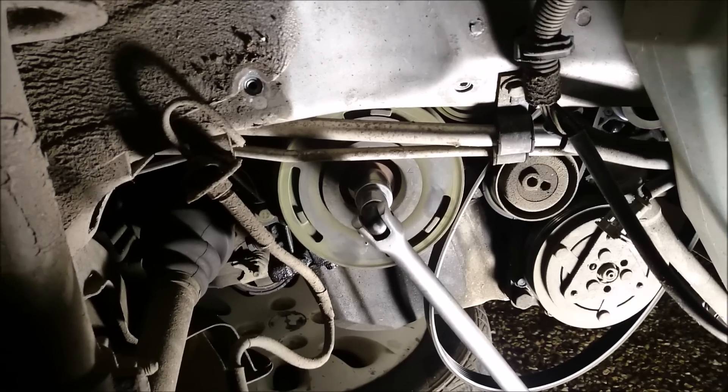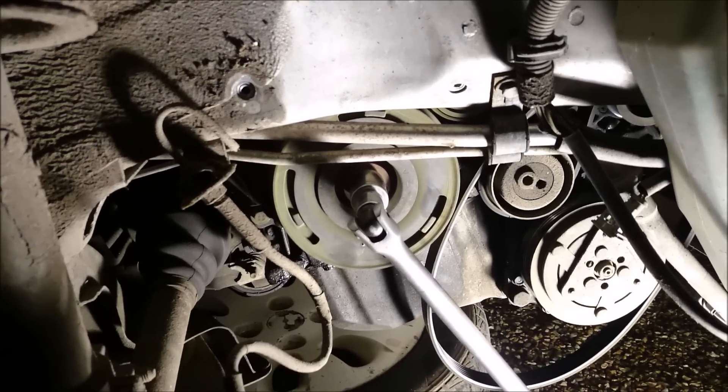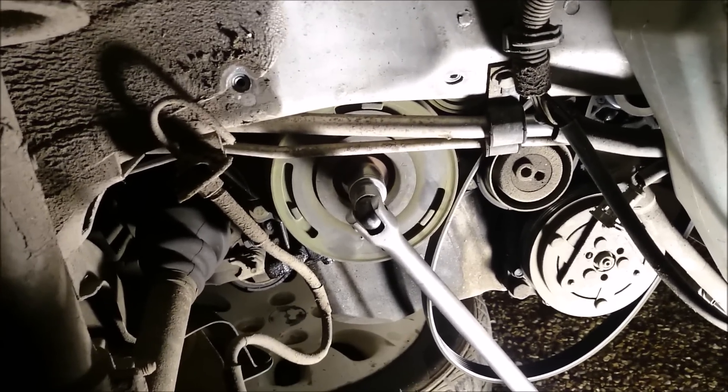You've got to be quick with your starter motor — make sure you blip it and turn off. You don't want your engine to run away with you. If you had a petrol, you could disconnect the coils if you wished, to stop it starting. This does work — I have proven this — but it's not my favourite.